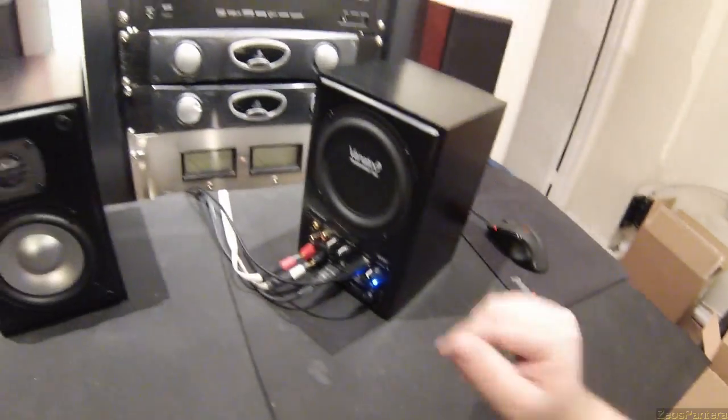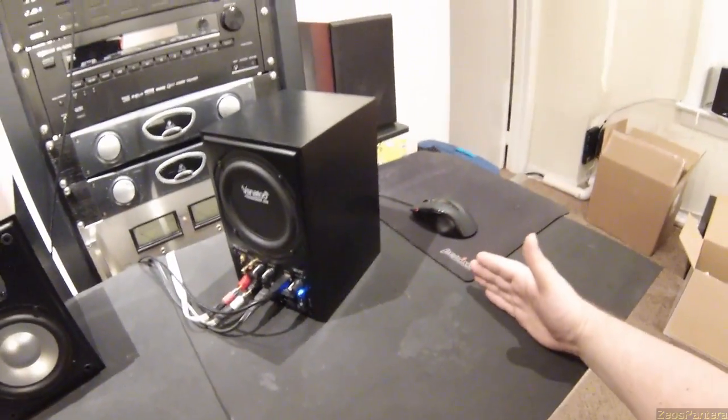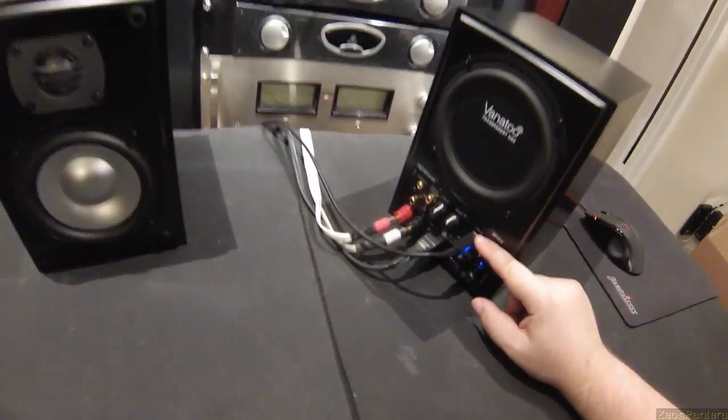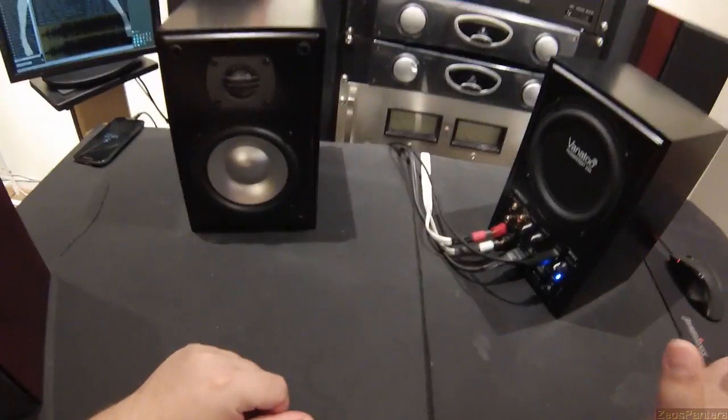And I've hooked it up. My only problem with 120 hertz is it's slightly higher than you'd ever want a subwoofer to start playing, especially for music, because it starts to be locatable. If I put that sub on with this sub out, you're going to hear some of the sounds coming from there. But these will then be able to use that volume to maximum. That distortion of it trying to throw the drivers as far as it can, that's only from low end, and that'll just go away.